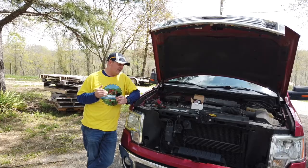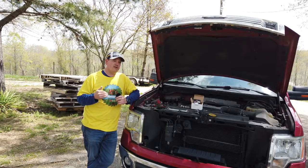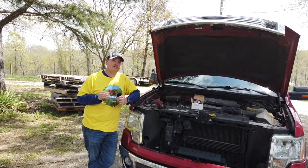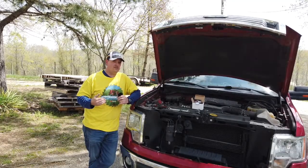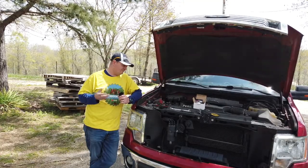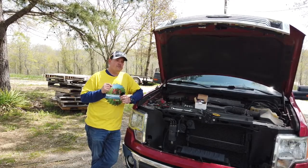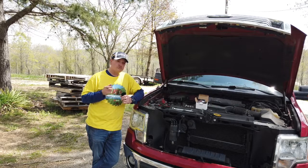Upon further investigation, I found out that you can actually buy a terminal for a different vehicle — like a Lincoln Mark 4 or a Ford Escape. I'll put a reference number in the description for this replacement. You just can't buy it F-150 specific; when you search it comes up for other vehicles but it also fits the F-150. If you buy the one listed as F-150 replacement, it's a crimp-on style terminal, but I found another one made specifically for this application that has bolts so you can just bolt it on — it has its own clamping system. That's what we're replacing it with today.